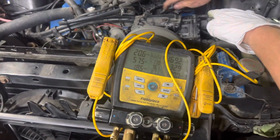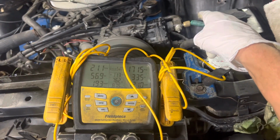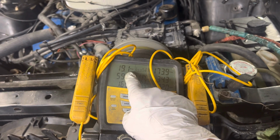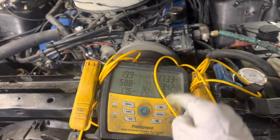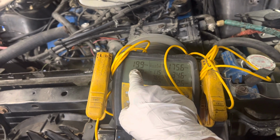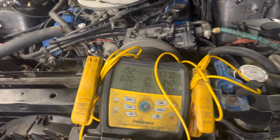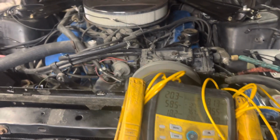Nothing's controlling this right now, but the expansion valve is modulating, trying to keep the superheat at a certain temperature. So now we're getting back to where I think we'd see is 19, 21, right around in there. But we have no thermostat turning off the compressor when it gets cold enough where it should turn off. It just stays running. But see, now the expansion valve's doing its job. Right. What we probably had was. Okay. All right. So it's hot wired right now.